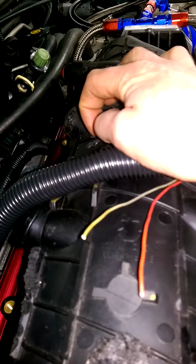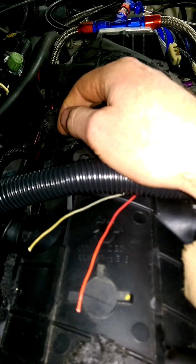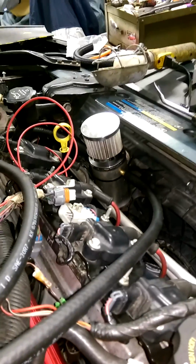But you can do that when you do this truck intake manifold because things like this right here are blocked up by RTV sealant. I'm gonna whack that off and plastic weld that and smooth it out. So whenever you use truck intake manifolds, to get rid of your PCV system or crankcase ventilation system, you can do that. Get a catch can and mount it right there or wherever. I don't care. It's your car.